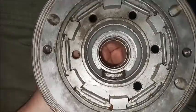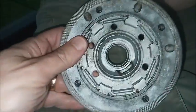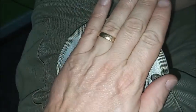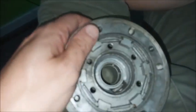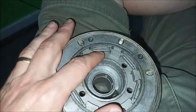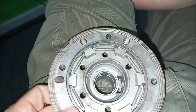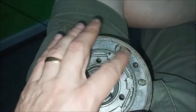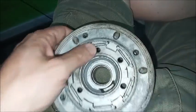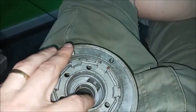So these five holes are the way atmosphere gets in. There's always air in here. And this will be covered over, but there's always air in here. And the air control system controls whether air makes it from here through these holes, because these four holes lead to these four, and that's what leads to the vacuum chamber. So whether air is allowed there or vacuum is allowed there is controlled right here.